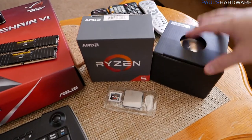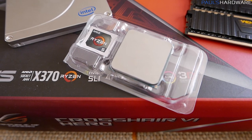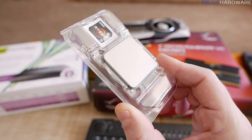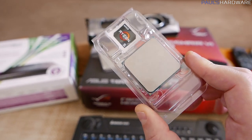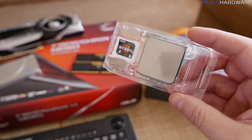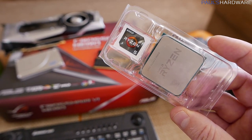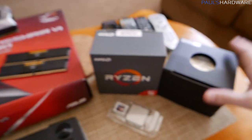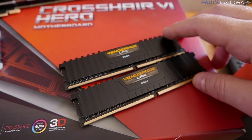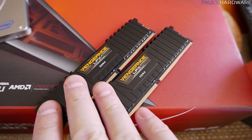Beyond that, I have the Ryzen 1600X CPU. This one doesn't make the most sense — practically speaking, you should just get a 1600, especially since I'm probably going to be passively cooling this and might need to underclock it. It would be much more practical, but I'm going to get more use out of my 1600 in builds for people since it's a more practical price-to-performance processor. For now I'm just sticking with a Wraith cooler, but I do have that passive cooler coming in very soon. For memory, I've got Corsair Vengeance LPX — a 3000-speed kit. It's low profile so it shouldn't conflict with that cooler once it arrives.